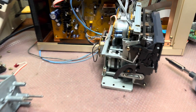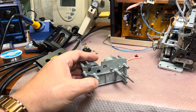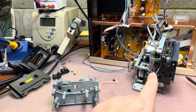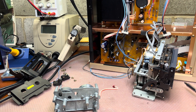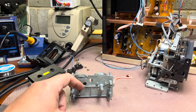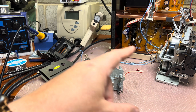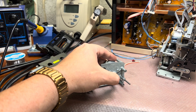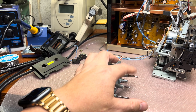Now we're at the appropriate speed. Interestingly, it's not the electronics — as I showed before, pulling down the left pinch roller changed the speed by about 50 Hz, and with both the old board and the new board the change was 50 to 60 Hz. So that confirms it's not electronics. Something was wrong with the capstans: they couldn't work as designed and couldn't pull the tape properly.